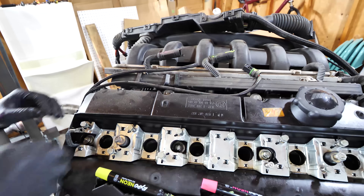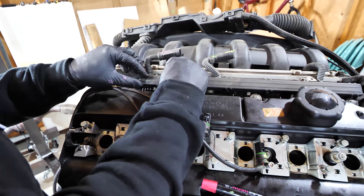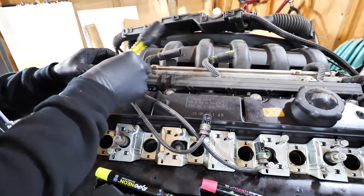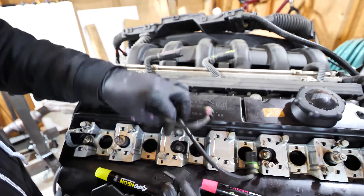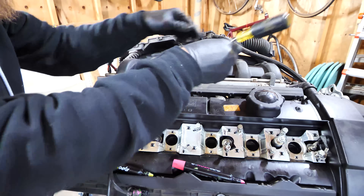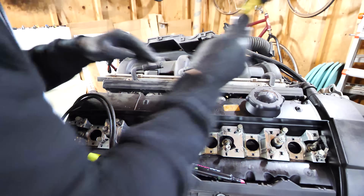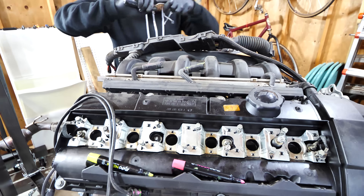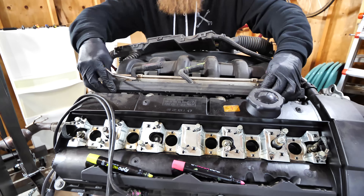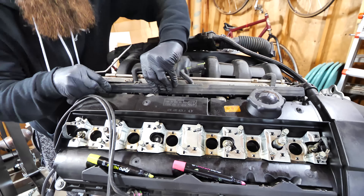If you have to take your O2s off, that's how they route — we'll shove them right back in. The ones we actually need to get off are not those but this whole fuel injector situation here. I'm going to take this little cover off and see if we need to unclip anything. Be gentle with this stuff — you may have brittle old plastic on your original S52 harness. Filming it yourself for reference is a good idea.